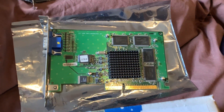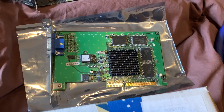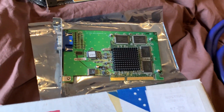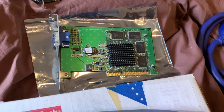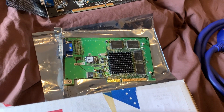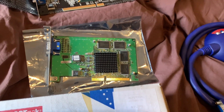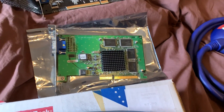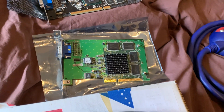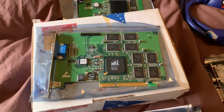This particular card is a Velocity, an OEM-style card with only 8 megabytes of RAM and one texture mapping unit enabled. You can driver-hack it to enable two TMUs, and it still runs at 143 megahertz — the same as the Voodoo 3 2000. A great budget card, though limited to 8 megabytes of RAM, which can affect performance in games like Quake 3 at higher resolutions.